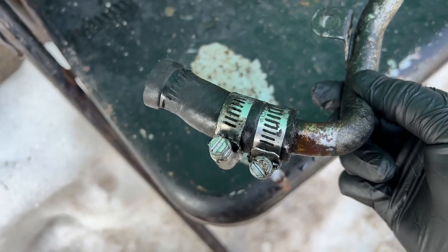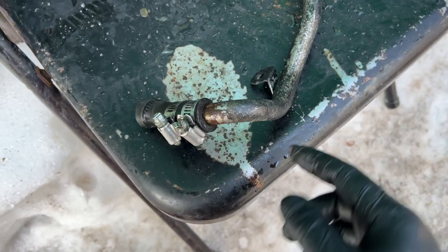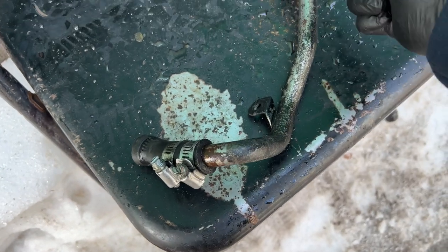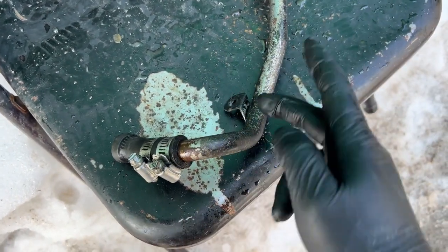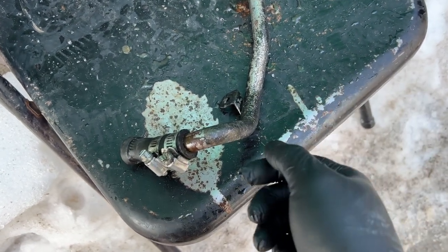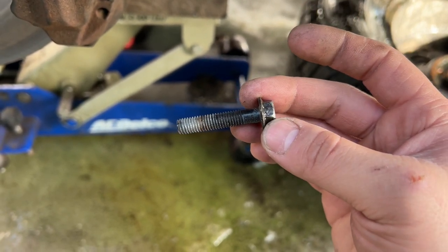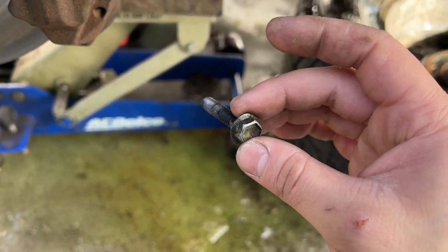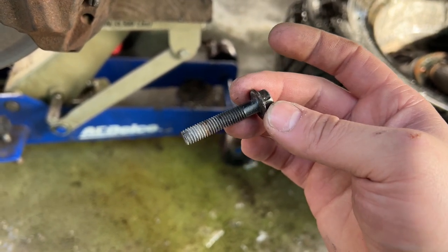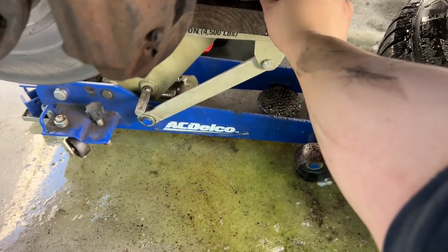Here's the pesky heater hose — the hose that goes to your cylinder head, which is known for failing. This one was still working fine, but we're going to bypass it by running a long hose from here straight to the firewall, skipping all of this. That setup is what I already have on my red Land Cruiser. This is the 12mm bolt holding the EGR pipe — I was able to get the bottom one but I can't get the top one because I can't get good leverage.